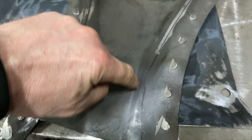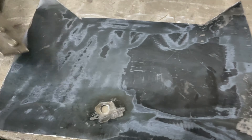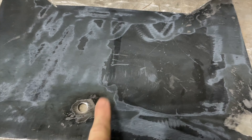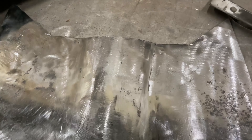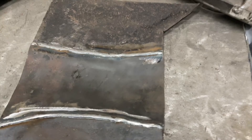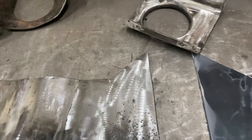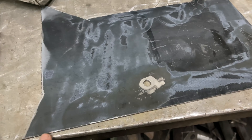Basically I'm going to put this X - I've already marked it out - so I'm going to cut that, and cut that, and then find the centre line of this, and then put that piece into here, just like I did on that one. So I've blended it all in - you can see on the other side where the welds are - and then we can put the piece in the front, the piece in the back, and then make up all the bits to fit in.